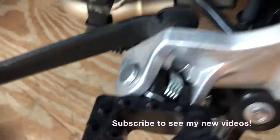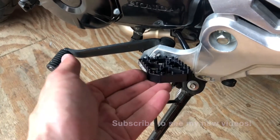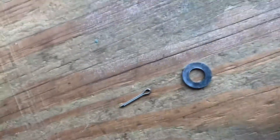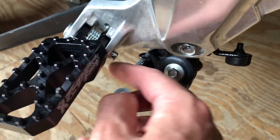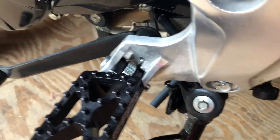I got the peg in — pretty easy. This is the left peg going into the rear set, and even without the hardware in the bottom everything is good; it springs up. All we have left are these two parts: the washer and the cotter pin that Two Brothers supplies as a replacement, because you had to basically destroy the first one to get it off — which is fine and expected. So I'll put the washer beneath it, put the cotter pin through, and bend the left and right of the excess back so the pin cannot come off.